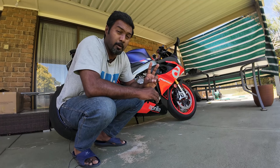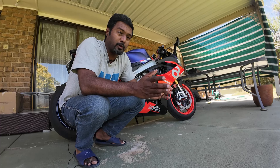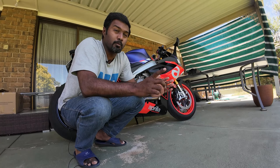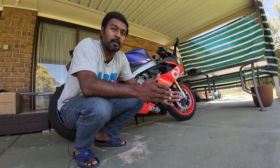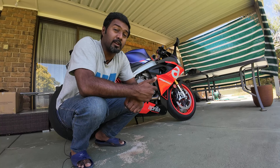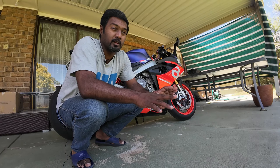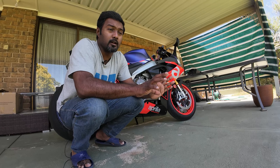There have been two updates from Aprilia. The first major update is that if you're following your 2021 manual on replacing the engine oil, please don't do that, because the 2021 manual says to replace around 2.7 liters of engine oil. But right now Aprilia have sent out a new update where you just need to fill up 2.3 liters of engine oil for our bike.